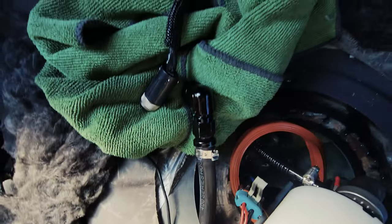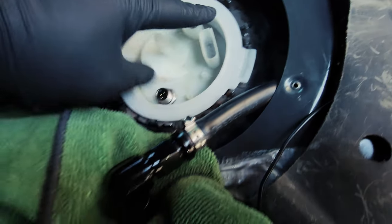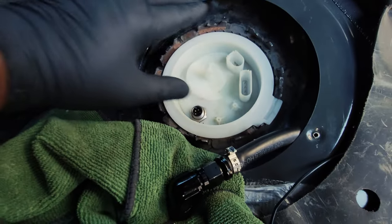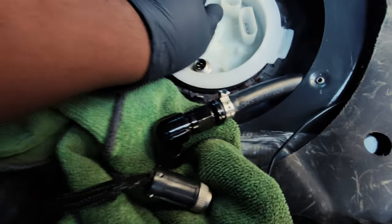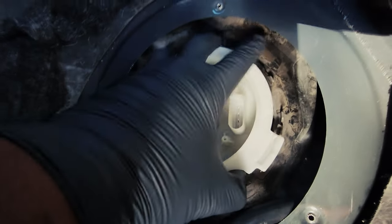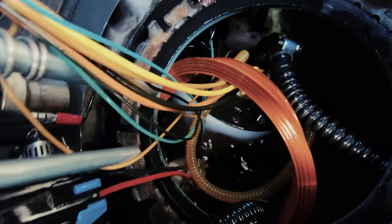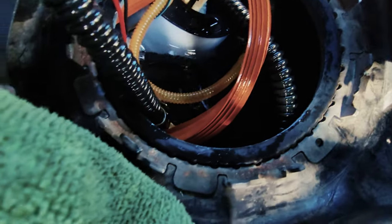I'll show you the wiring on this side. That's the top of the fuel pump — this ledge sits right there. When you put it back together, you know that's the correct orientation. There's literally one space this tab fits — try to put it anywhere else and it won't fit. This is how the top hat looks with the wiring going straight down. The second pump is right there and the first one is over that way. You can see the tee connection — it's teed to the other pump.